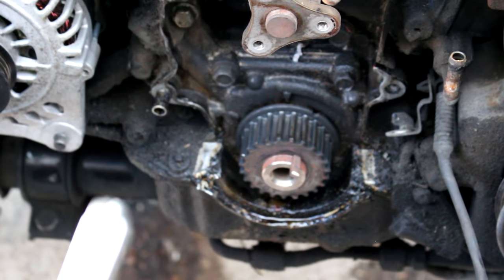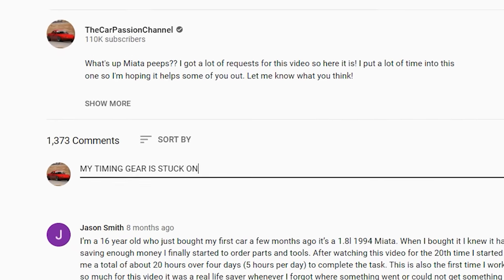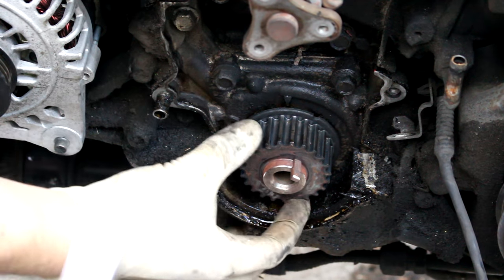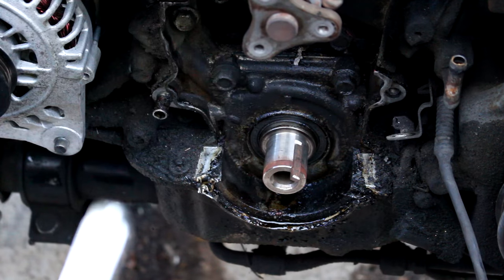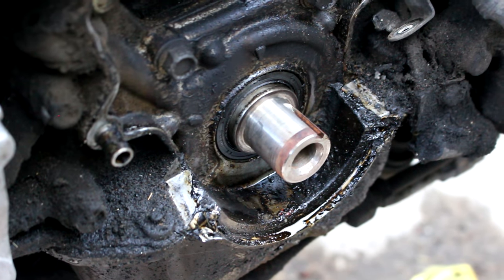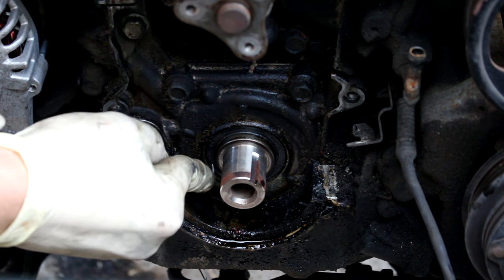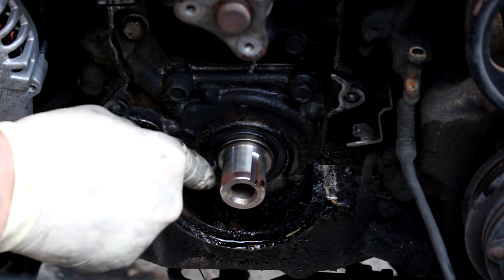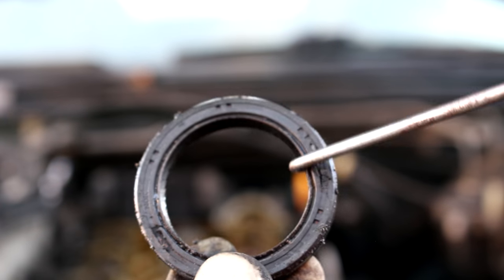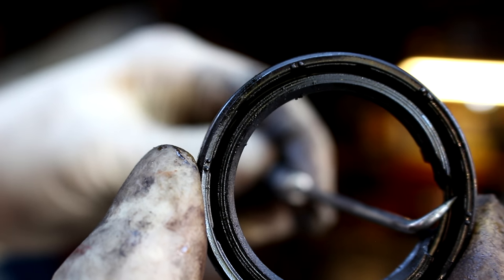Now, the infamous timing belt gear. I got so much flak in my other video because my timing belt gear wasn't stuck, and apparently everyone else's was. Maybe this will be the time I'm paid back and my gear is super stuck — but all I have to say is our houses might be expensive, but we got no rust out here. Watch this thing just come off with two fingers. If your gear is stuck, you can apply some heat, or pry on it lightly with a pry bar — not enough to break your oil pump, but even pressure on the left and right sides to pry it off. Next, the front crank seal has to come out. I just use a 90-degree pick, stick it into the seal, hook onto it, and pull it out. The biggest thing is you don't want to damage any of the sealing surfaces. If you flip the seal around, you can see there's a metal ring inside, and that's what I'm pulling on with the pick.